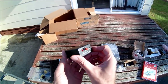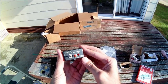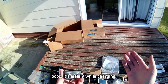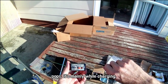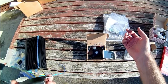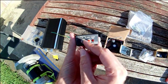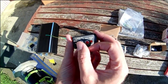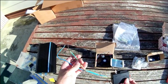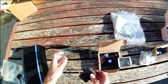This is called a turbo timer. People generally use it to keep power on their turbo fans after stopping the engine. You go for a drive, come home, turn the car off — but you still want that fan going because the batteries are still going to be bubbling out some hydrogen for a few minutes. So this lets you keep that fan on for another one, three, or five minutes or whatever. You can also just turn it off manually. It's a little timer that you hook up to the fan to keep it going for a while after you've turned the car off.